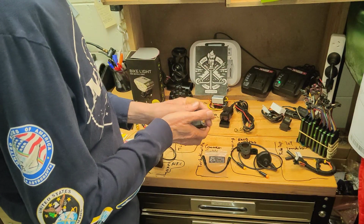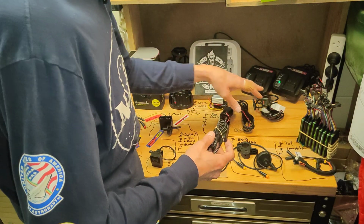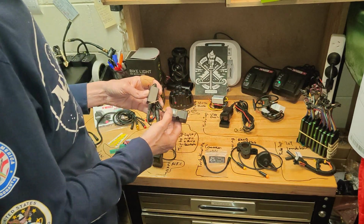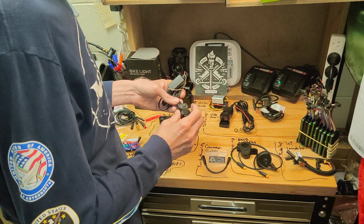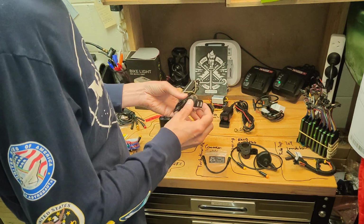And they also, at least in this version, and I'll have to check if the others apply, but I think it's all the same, is that it actually can't deliver the required current to maintain power draw or quick charge. So you don't get fast charging out of it, even though it's fast charging capable. If they're connected to a 12 volt circuit, no worries, 12 volts, fast charge.